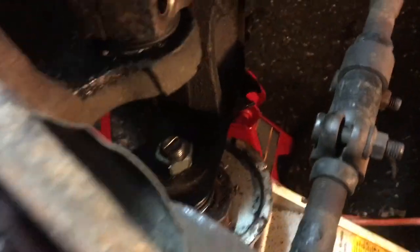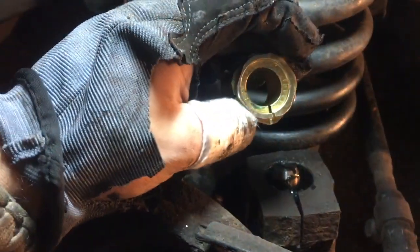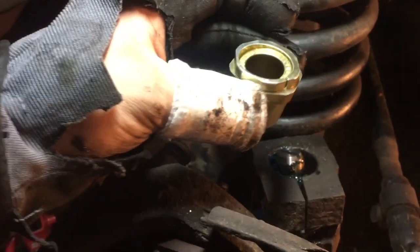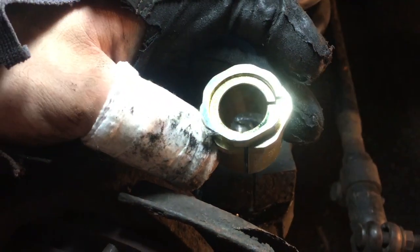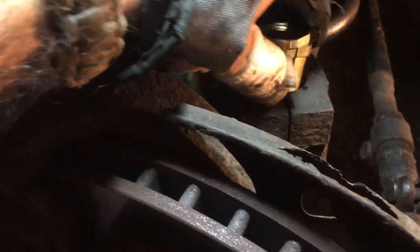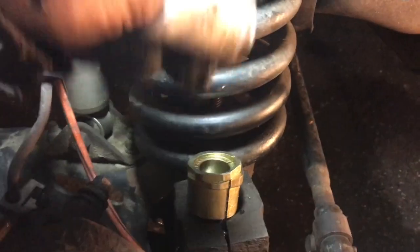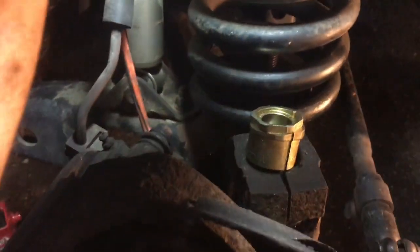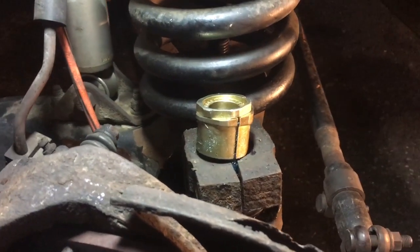I replaced the ball joints as I said I was going to, and I'm back to put this new camber nut in. I played with the settings on the other side to get a configuration I like, which in this case involved this particular arrangement with the markings. Basically, you put the nut in, take a socket that fits right in the top and hammer it in, and then you're set. If you need to make adjustments, these big sockets fit right on top and you can adjust it every which way you want.